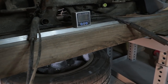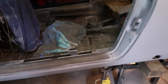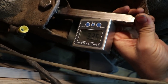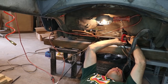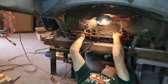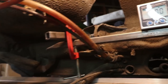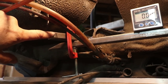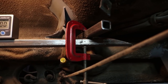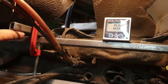I got this bar now level — this is now reading zero. Because I have the car supported the way it is, it's on a very severe rake. So I just want to record that number here at the door sill. Now I'm adjusting this to the same angle as the way the car is sitting. So now I have these bars attached to the suspension mounts, and then this bar spans them and attaches to the other side. This gauge on top is zeroed out so that the heights of these legs are even on both left and right.